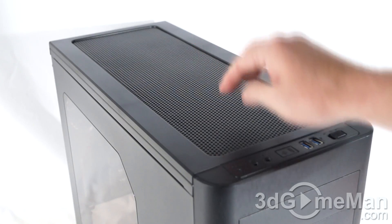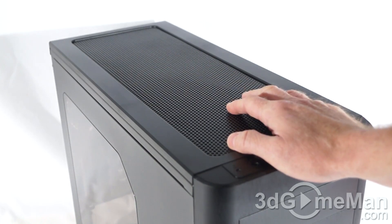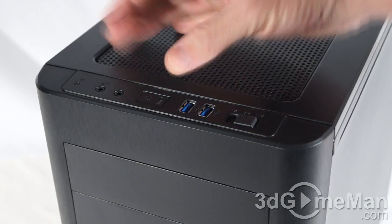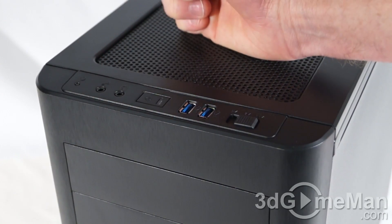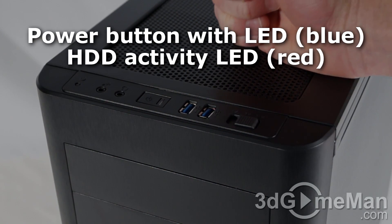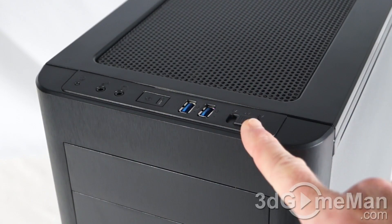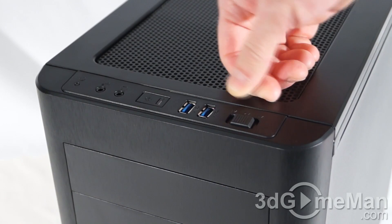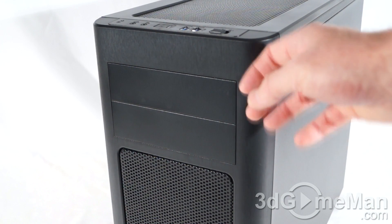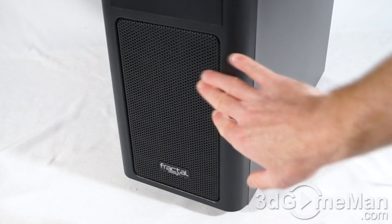You can install up to two optional 120 millimeter fans at the top. They include one 140 millimeter fan; you can add another 140, or a combination of either. You can also install a pretty large radiator at the top. At the top front is the reset button, which is recessed so it's not easily pressed. There's a quality power button alongside a power LED, two audio jacks — one for microphone and one for headset — two USB 3 ports, and a fan speed control with three settings: high 12 volt, medium 7 volt, and low 5 volt. The front panel looks like aluminum but it's actually plastic. There are two 5.25-inch drive bays and mesh at the front for excellent ventilation, which includes a fan filter.